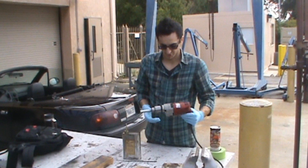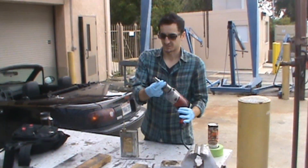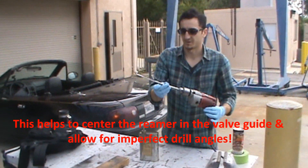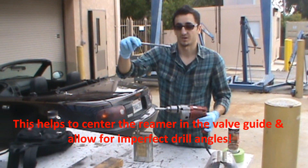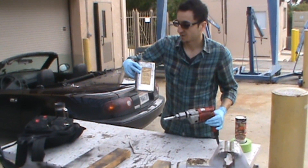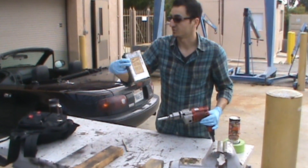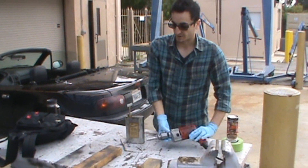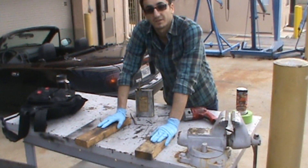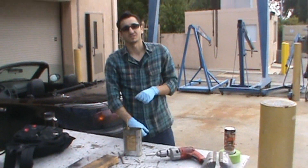So basically all the tools you're going to need here is an electric drill. We've got this little piece in here that lets the actual reamer kind of walk around a little bit — it moves around. We have the reamer here, and then we have some lubricant to make sure that we don't take out too much material. When you're putting in bronze guides like we are today, you want to make sure you're using bronze lube. And we're going to have a couple pieces of 2x4 to keep the cylinder head off the ground. We want to do this probably at floor level, straight above the guide.